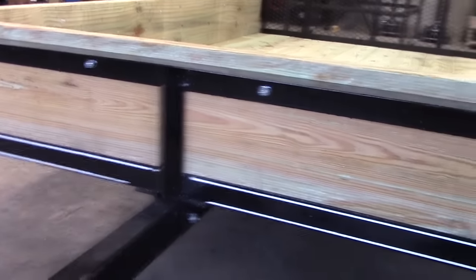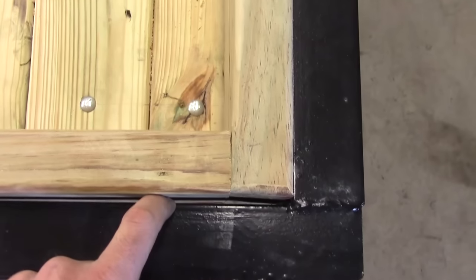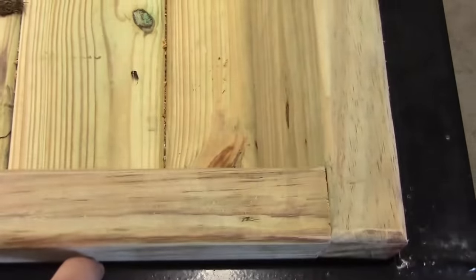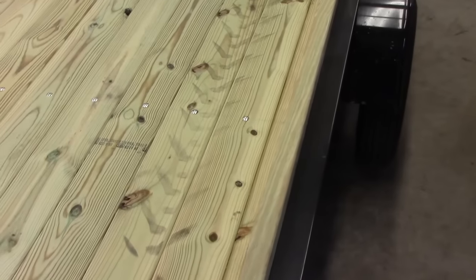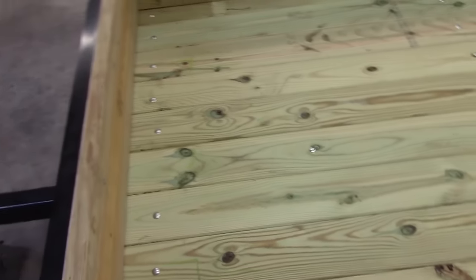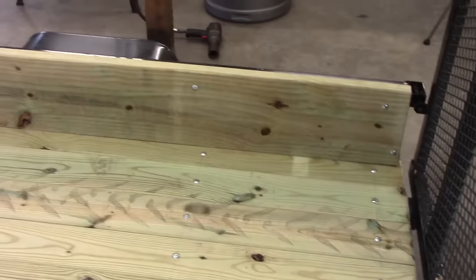This outer frame is actually screwed together — the wood screwed to the wood. I put two bolts through the middle. We did not put them out on the edges because the way the trailer is made, there's a little gap up top but not at the bottom. Rather than trying to bolt it there and risk splitting the wood, we just bored it in the middle. We went right down through the meshing and used big fender washers and lock washers to put the sides on.